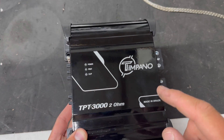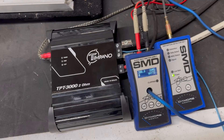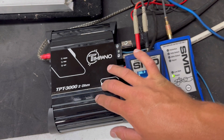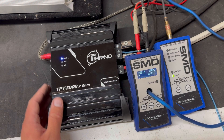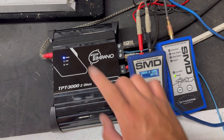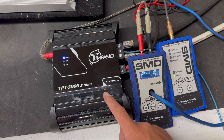Let's go ahead and hook this up to power and RCA and see what it'll do. We'll put this on the dyno setup and see exactly how much power this thing makes in a dyno application. I have zero-gauge wire coming in so we can get as much power out of it as possible. We're holding steady at 14.4 volts on the power supply and lithium bank. You can immediately hear the fans come to life — roaring away. The meter is set up and the resistor bank is set to two ohms, so we're going to run 40 hertz through it and see what we get.